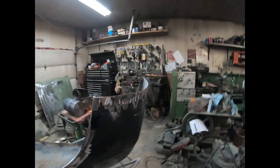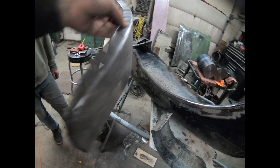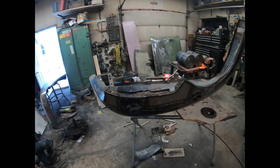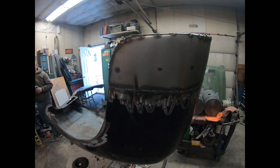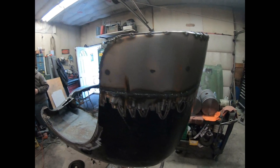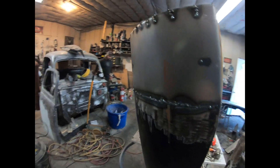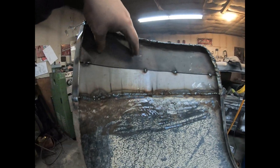That's how I made the driver's fender. If we had the proper tipping tool I wouldn't have to use all these pie cuts but we're doing what we can and it'll come out good. Here's the fender - it's all been welded but not been ground yet. This came out very nice - the curve will need basically no bondo along here, just along the top where I pie cut it. I got the brace inside and we just have to drill two mounting holes for the running boards.